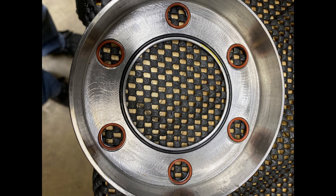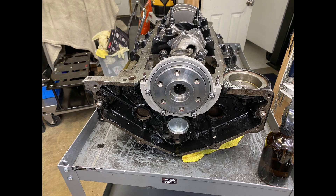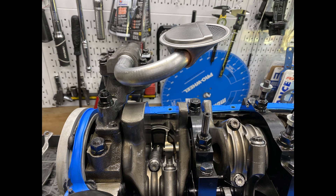That cap right there and there are O-rings to keep the oil from even passing by that. You also have to put thread lock or thread sealant on your flywheel bolts because oil could come and seep through that.